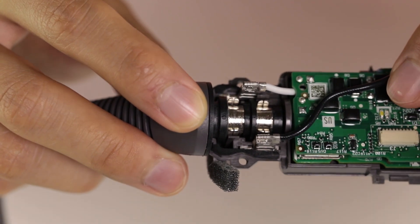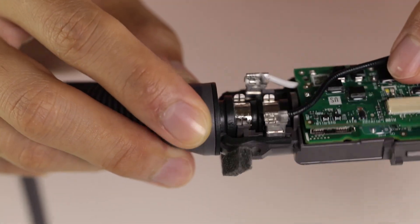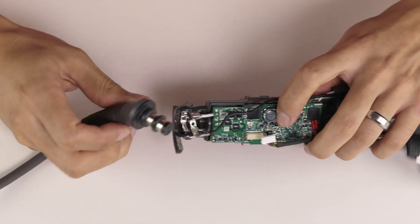To prevent tangled wires, Dyson designed a custom slip ring. This required custom contacts, lifetime testing, and conductive lubrication to get this to work well, and is a really difficult engineering feat to get right.